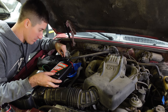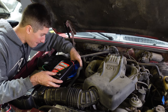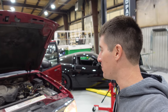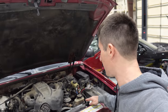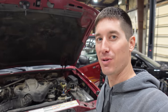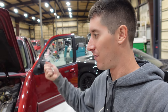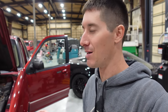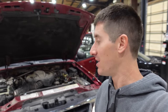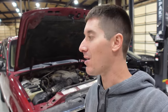It is time for the fluid fill. The dipstick is back in its hole, everything is wrapped up, battery's connected. I just finished vacuum filling the cooling system — everything seems to be working pretty well. Checking and filling the transmission fluid, of course, like eight times — because you have to check it and then go shift reverse, neutral, drive, do that a few times, then put it back in park and come out and check it. Now it should be dead on the money. It seems like it's shifting just fine.